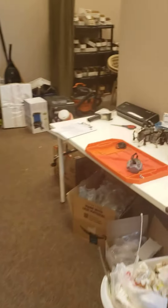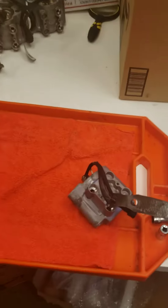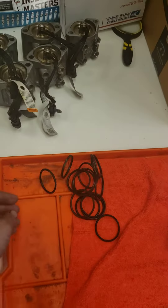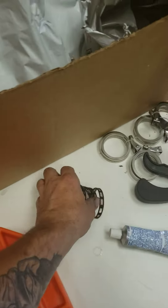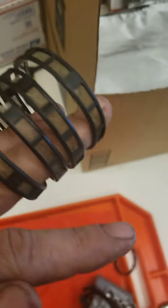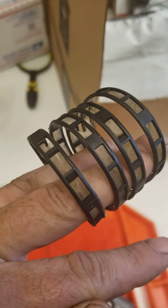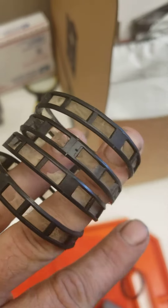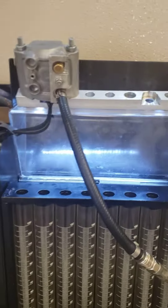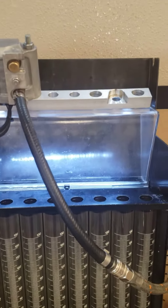This is number one out of seven, so these are all back together and hitting the testing. You've got all the old seals and stuff here. Five out of seven injectors had busted screens, so those have all been replaced — there's broken parts of those screens right there. A lot of changes already, just aesthetically — seals, filters, and all that. We'll see if they all flow like they're supposed to.